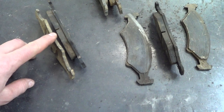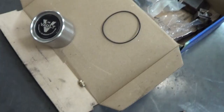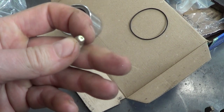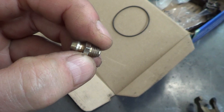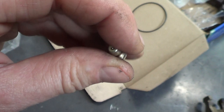I will not take the "no service required" advice and will instead treat the hubs just as a regular hub. I converted all of them from the hybrid oil to normal grease, and I can treat it as an EZ-Lube hub by installing a grease zerk and greasing it just like normal. I thought about installing the zerks permanently on the end of the spindle, but it would be really difficult to clean those threads completely, and if it fell out while driving that would be really bad. So I'll just install and uninstall the zerk each time I need it.